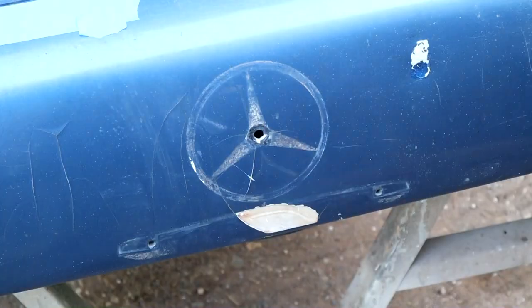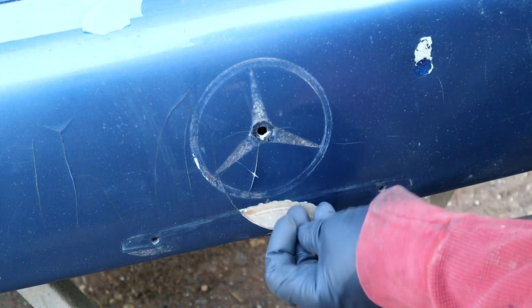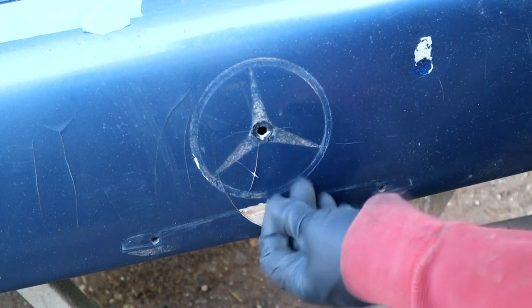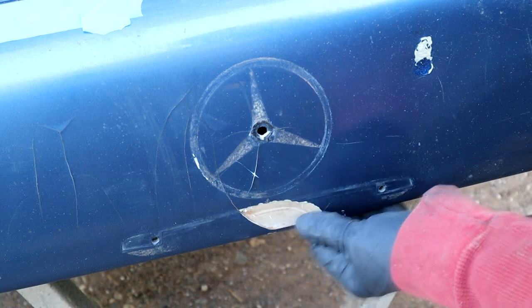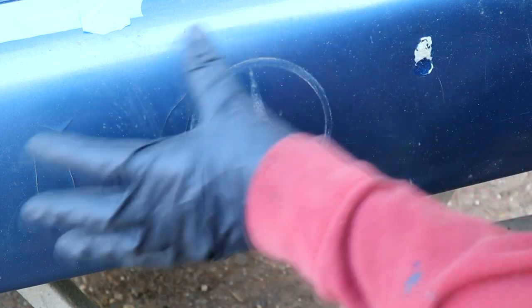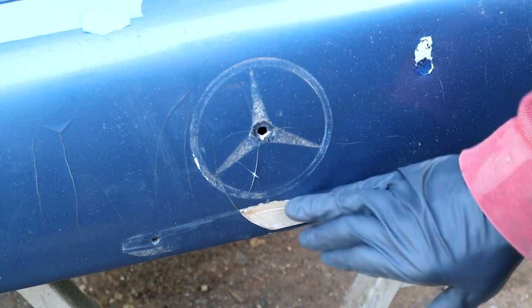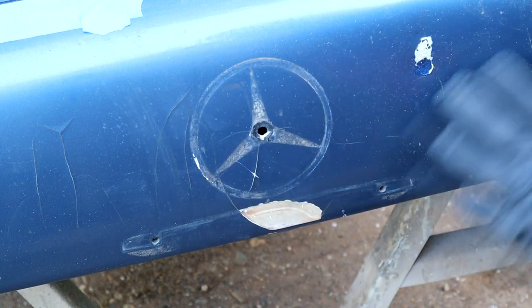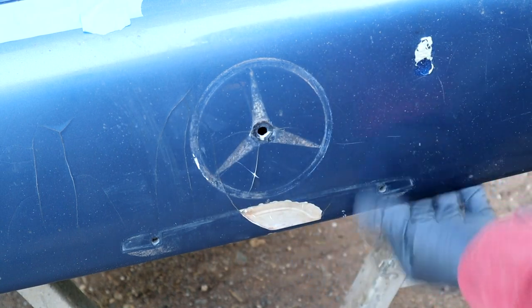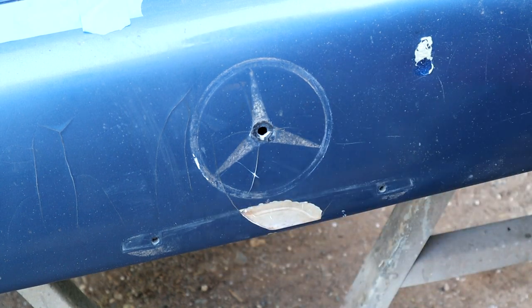This is an area on the trunk lid that's chipped off, and you can see the thickness of the paint on here — it's so thick. They've piled straight on top; probably got some filler in different areas. It's so thick that it's started to craze and crack under the load and the flex, and the finish is obviously failing.